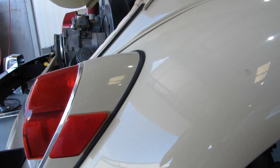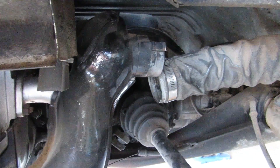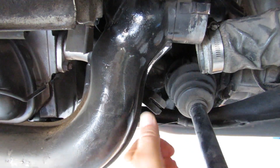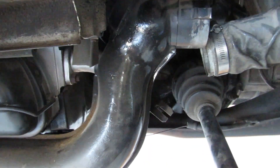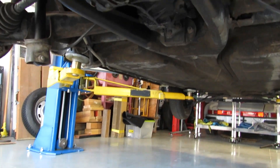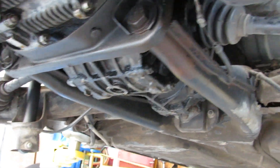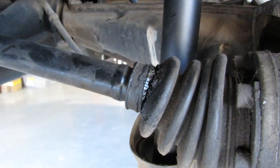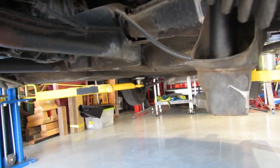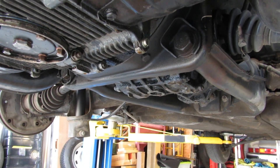Underneath the car, I've got the heat exchanger tubes removed, and there's this thing right here — it's the flapper that's inside that allows air to go up to the front or not. One thing I noticed is that although it's really clean, the transaxle itself is quite greasy and oily, and it looks like the boots and things are split on the CV shafts, so I'm probably going to have to reseal all of that.